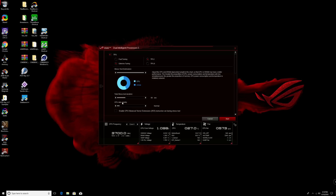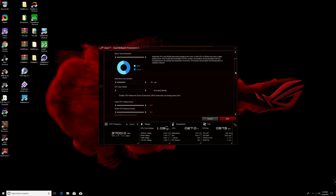The next step is making an adjustment to the CPU ratio stability. This is essentially how the system determines the algorithm being applied and what we approximate as fully stable. In most situations, normal is going to be very good for general usage — opening applications, browsing, playing games. If you're a more demanding user running heavy multi-core, multi-threaded applications or concurrent workloads, or you just want the highest level of stability, I recommend dropping this to encoding stability. That helps ensure the highest level of stability even if your CPU frequency is limited a little. There's also an extreme option — support for AVX instruction sets — which for the vast majority of users is not required.